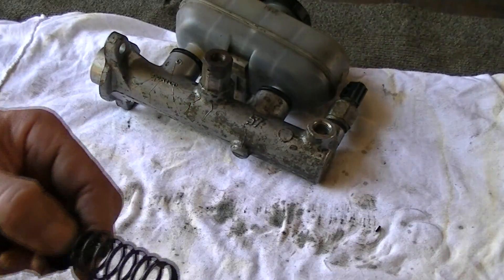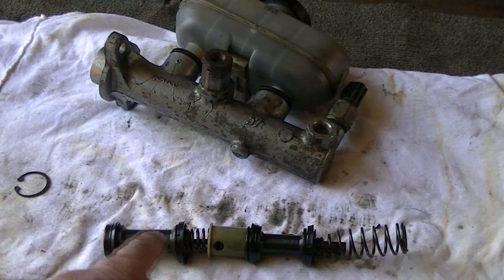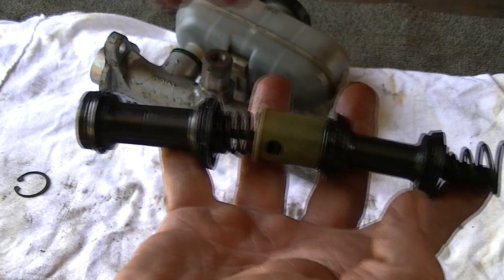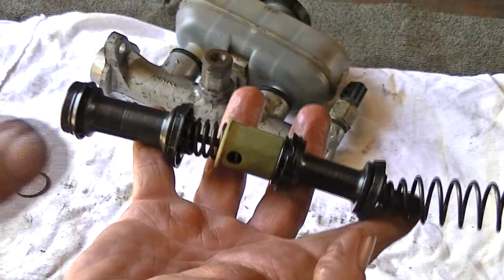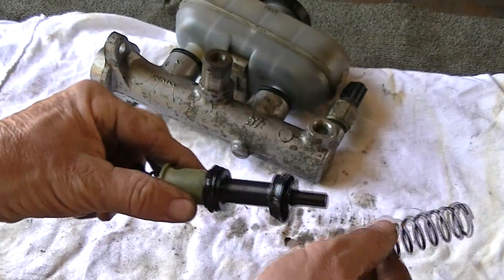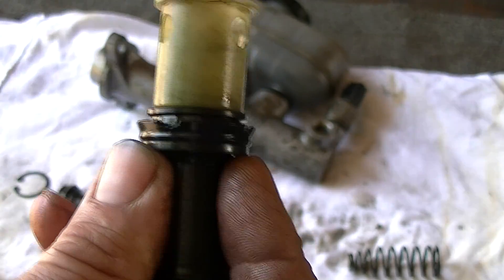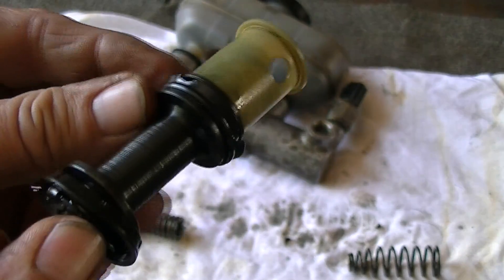This whole system goes in like this — this is how it came out and how it's going to go in. You have two chambers, and brake fluid runs down into here and here. When you push your brake, there's a rod that pushes this, and the fluid gets in front of these seals and pushes the fluid down the brake line — that's what works your calipers, and that's how your brakes work. Right there is our issue. See how badly that seal is torn. So I'll just keep this in the garage and maybe someday I'll find a seal kit for this — it's worth keeping and rebuilding.